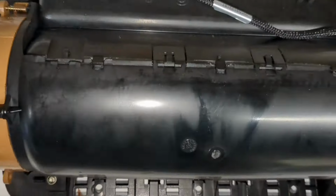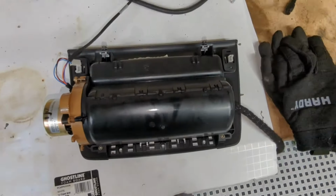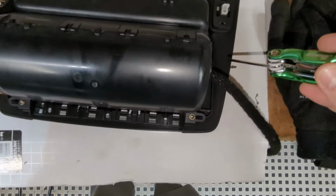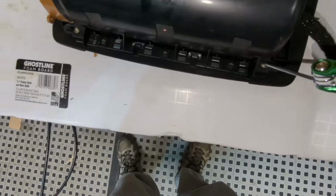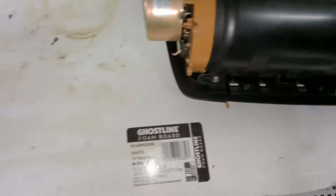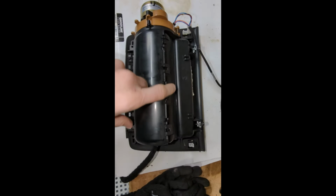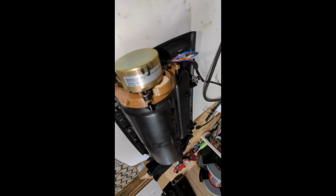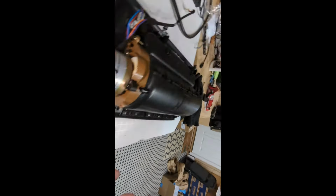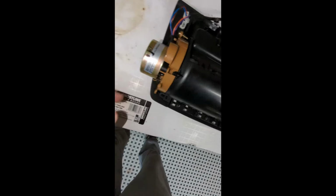All right, so I popped these wires out. The next step is to undo these screws around the perimeter. This one here, here, here, and that's it. Looks like three screws. We're gonna undo these. They're T10. The screws are undone, these locks are unlocked, it's still not coming out, so my guess is I'm gonna have to remove this motor here, and it's gonna be kinda easy because this piece is broken, that's broken.